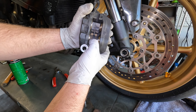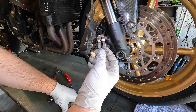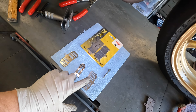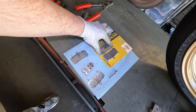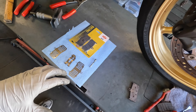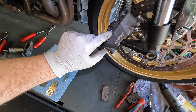Go ahead and remove the clip. Now that I've got the clip out, I'll clean it with the brass wire brush along with the brake pad backings before reassembling. Now that all these components are clean we're ready to put everything back together — the backings go on the back side of the pads, not the friction side. Make sure that clip goes in first, get it all assembled, reinstall the pin, then bolt the caliper onto the fork before torquing that pin down.